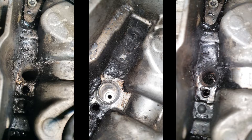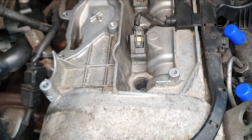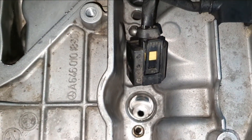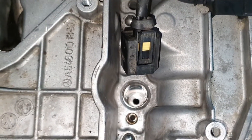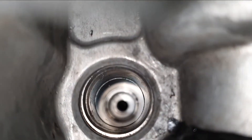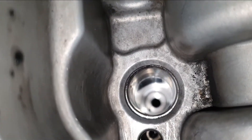Regarding the black death or the carbon buildup, the best way I found for cleaning this was using thinners, then plenty of rinsing with brake cleaner. Make sure you plug the ports with some cloth so no liquid falls inside the engine, because you don't want to dilute the oil. After cleaning the ports, I reamed them with a reaming tool and now we're basically ready for installation.